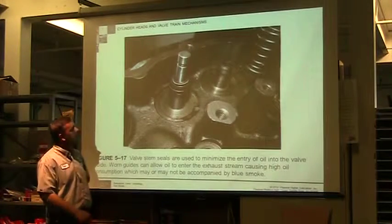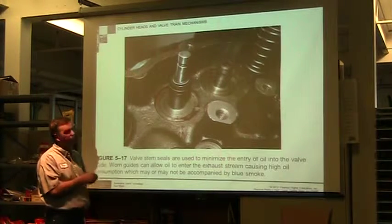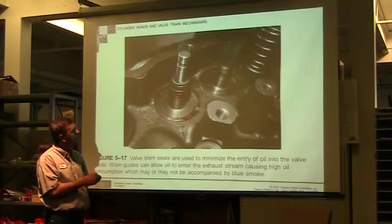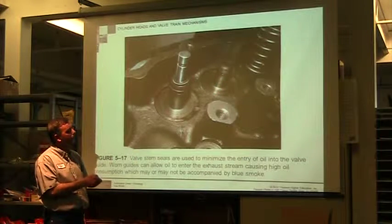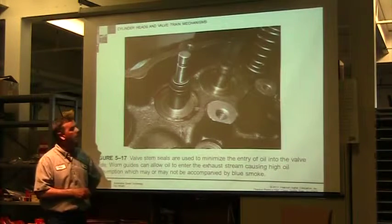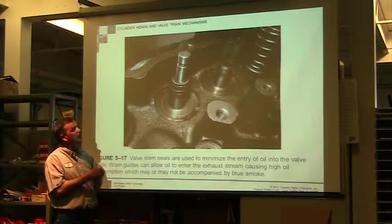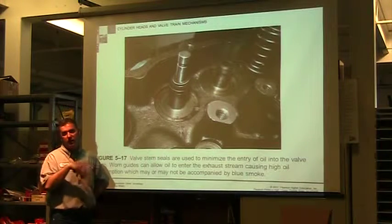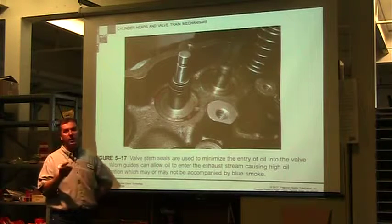Look at the top side. We have valve springs. Underneath the spring on the intake side will be a valve seal. Some engines have valve seals on both intake and exhaust. Some just have it on intake. On the exhaust side, because this valve guide is pressurized, you have exhaust gases that are going out, it's pressurized, we're not going to actually push or pull oil in. We're going to be pushing exhaust gases up that valve stem and up into my engine. That's going to contaminate my oil,